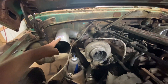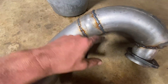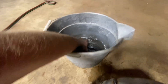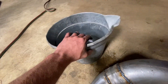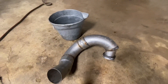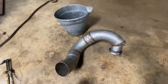Pretty self-explanatory. My piping is done, all welded together. This is a coupler to join the two four inch pieces of pipe — I had to chop it down because it was too long and getting into the bend. Now we're putting heat wrap on it. I've found that if you put the heat wrap in water and let it soak, you can stretch it onto the pipe a lot better. When it's dry it works, but it's a lot more user-friendly wet — try it out, it works really good.